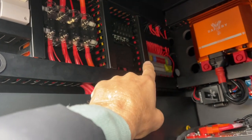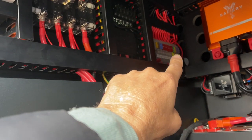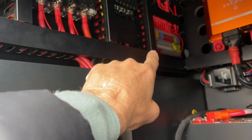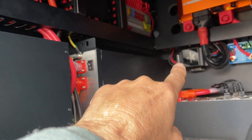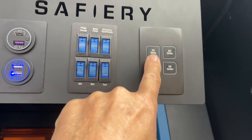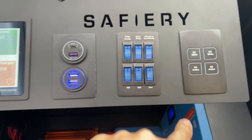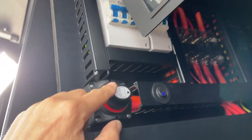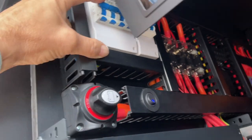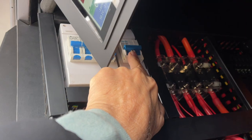I can turn the other one on — you can see all six are coming on. Or you can manually lean across and hit a button there for backup. Then we've got our 12 volt power distribution at the back; when the drawer goes in here you can still lean across. If the LED comes on, it means there's a short circuit. The smart switch is in the rear, which means this switch is running both sides — same switch both sides, activate on one side and it activates on the other at exactly the same time. Then we've got our isolator on the end, very easy to get to. RCBOs up here — we've got a big one on the end because we've got the electric hot water, so four RCBOs. And then that's the solar breaker.